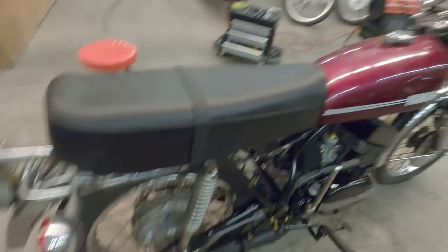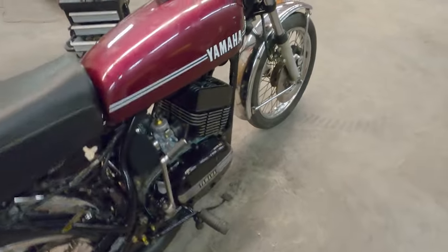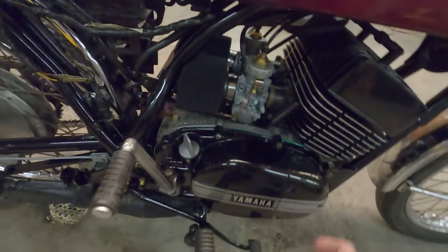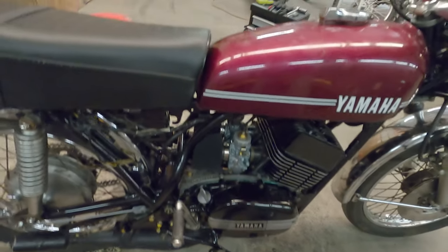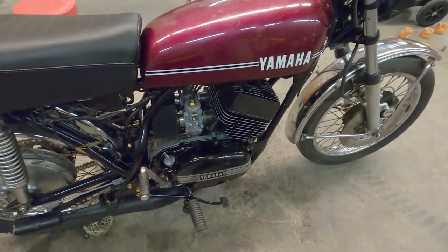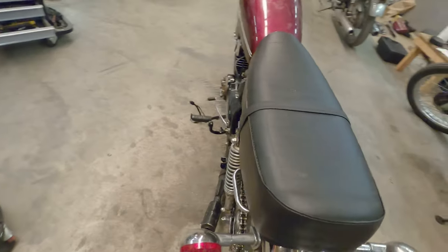The RD 350 has come a long way, but unfortunately we may be taking some steps back. There's tons of little stuff that needs to be taken care of — still need to rebuild the caliper or try out the new pad, need springs for the expansion chambers. The carb situation is not looking great because the needles are super small compared to the size of jets I need, so I'll have to get a new needle jet. I still need a new pilot jet; I've got the main swapped out with 210s, but the jet needle is just way too small diameter for that big of jet.